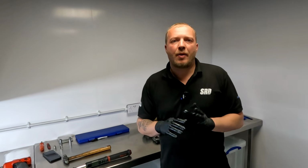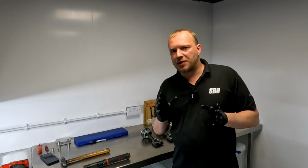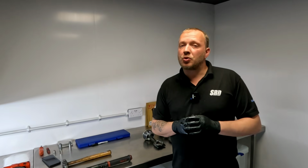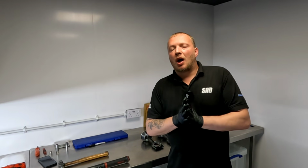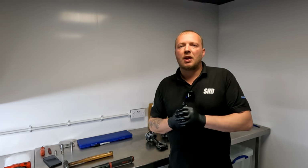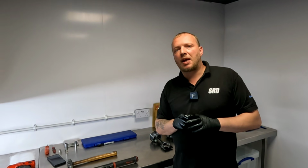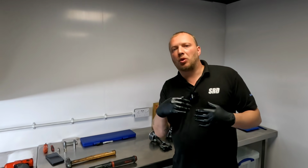So the rods and pistons are now out of this block, and they are quite strange already. I can see they've got a special coating over the bearing. There's also no tangs on the bearing, so the bearings will be able to go either way round. From a lot of information that I've read and engines that I've built over the years, tangs aren't necessary. The tangs are only there to make sure the bearing is central within the connecting rod or the main journal.